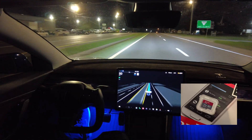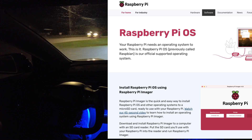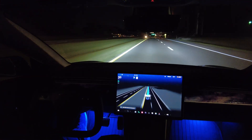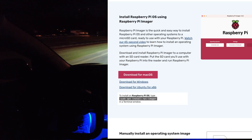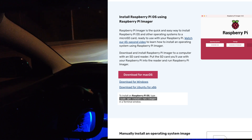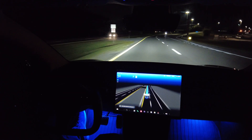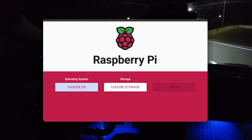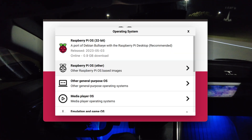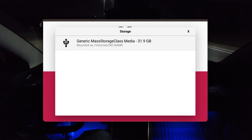I started with a brand new SD card and headed over to raspberrypi.com. Click on Software. We're going to want the Raspberry Pi imager — scroll down and you can get the imager download. Open that up and they're going to need an operating system and a storage device. Under operating system, if you go under Other, I like to use the 64-bit lite image. Back in Storage, I'm going to select my 32 gig memory card.